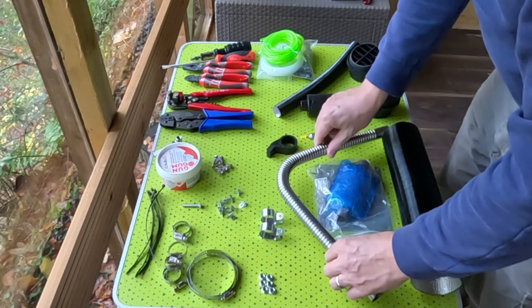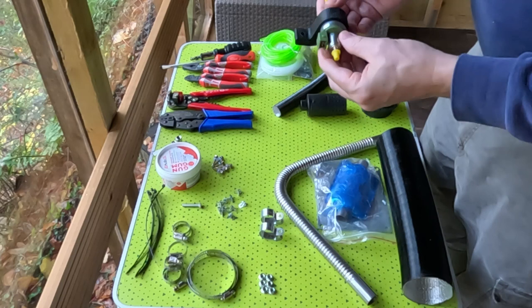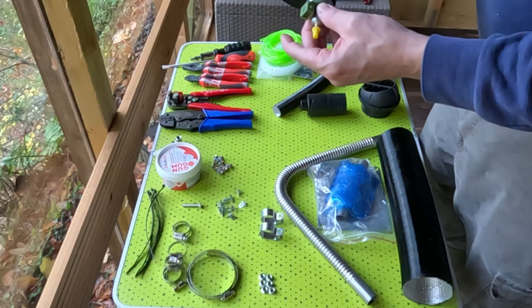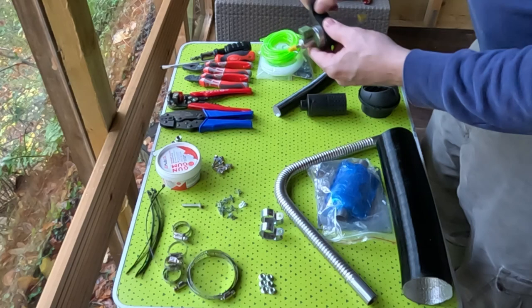We've got the fuel pump. We actually have a rubber mounting that holds the fuel pump, and that's to try and reduce the vibration. This is an electronic solenoid type pump. So the electromagnet switches on, pulls the center to one side, which pumps a dose of fuel, and then the spring returns it. So it clunks quite a lot. You need to position this at a certain angle, and I'll verify that and show you that when I fit it. It doesn't go flat, it goes one end up, but I just need to make sure which end.